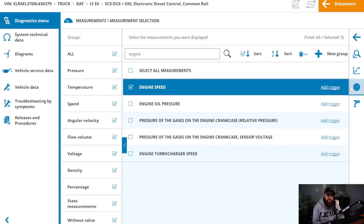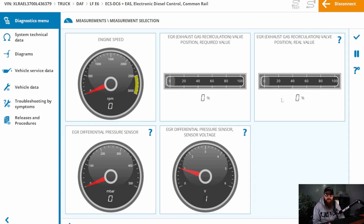With this pulling 26 millibar at idle, and me remembering I'd not cleared the faults, engine protection mode is most probably disabling the EGR valve. So we're not going to get a known bad flow reading to compare to later, so we will just get into this visually.